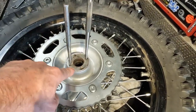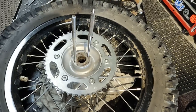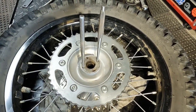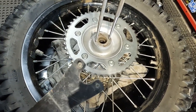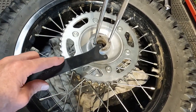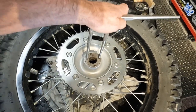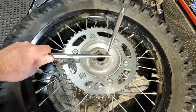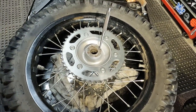They all have this weird locking ring — most bikes don't have that, but Honda thinks you need one. There are a couple ways you can get that off. Most guys just use a punch and a hammer, but you can sometimes make a mess doing that. You can also grab one of your old Makita or DeWalt grinder spanners and modify it so it's a little wider to fit. Or put a couple punches in there, hold them down from the top, put another punch in between, and twist it — it works pretty slick.